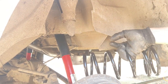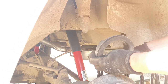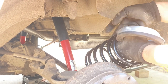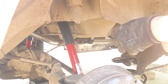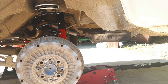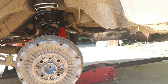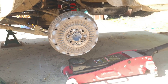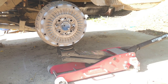The installation of the lowered springs is pretty easy because they're so small I can just put them in. Don't forget this rubber that goes on top - it's important that it's bigger because you have two sides of the spring and there is less space that goes on the bottom. We just put everything together and put it in place. Now we take the jack and put it on the drum brake so I can compress everything to fit the new shock and get everything level.